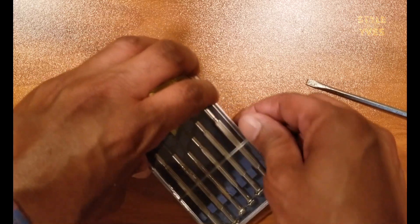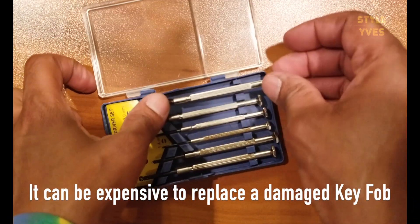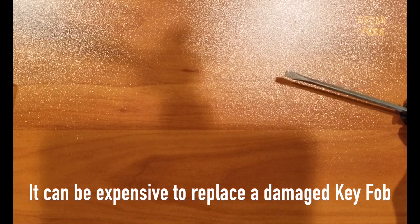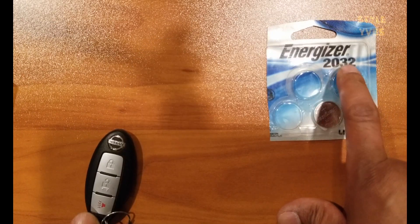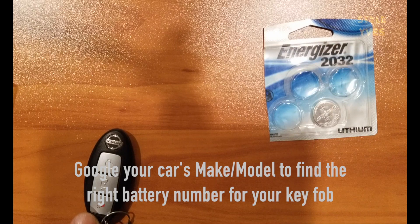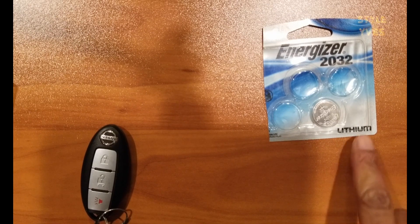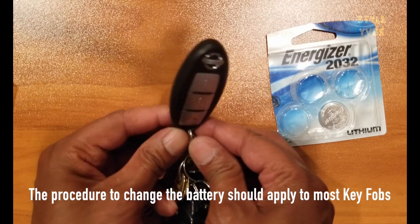So I'm going to show you exactly how to resolve this. We're going to need a flat screwdriver — pretty small one. I don't want to use larger ones because sometimes they're a little too sharp and can damage the key fob, so avoid those if possible. Also, this is the battery replacement, which is a CR2032 model. You can get them in Energizer or Duracell or whichever brand. I recommend you get the lithium one — this way you don't have to change it so often. This is for the 2014 Nissan Rogue key fob but should be applicable to any.